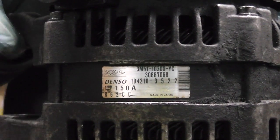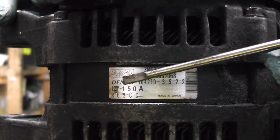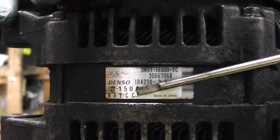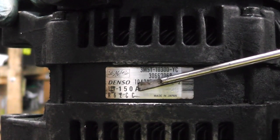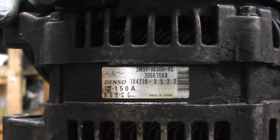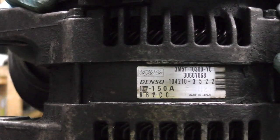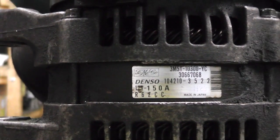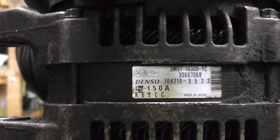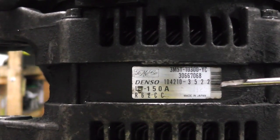On the sticker — it's a square, silvery sticker — the first thing is there's a little barcode on the side, and it also says Denso and it's 150 or 120 amp, which is basically the output. The other thing to look at is the black cover at the very back — a round black cover. If those two criteria are there, that's the alternator we're showing you today.